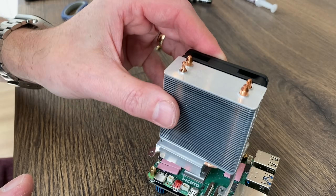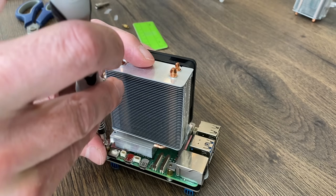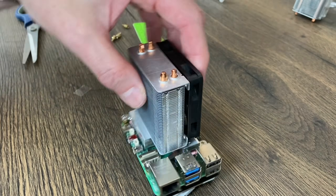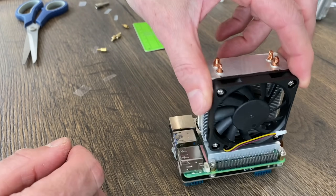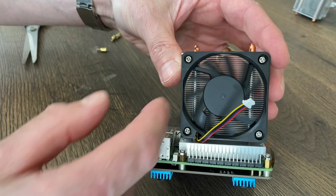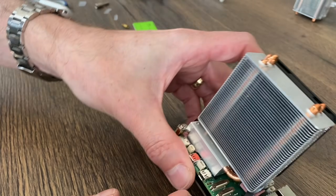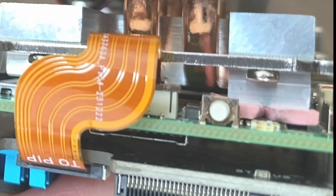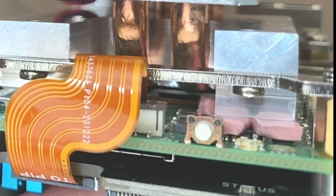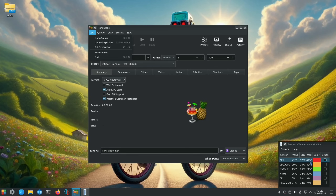Putting the cooler in place — I can feel it's made contact. Screwing it down with the last bolts. To make it a fair test I'm going to leave the fan unplugged for now, but I will plug it in later to check how noisy or quiet it is. You can see the thermal pad sticking through there, touching the power module. Currently the hottest it's got to is 42 degrees on the RP1 chip, but the CPU/GPU hasn't really been properly used yet.